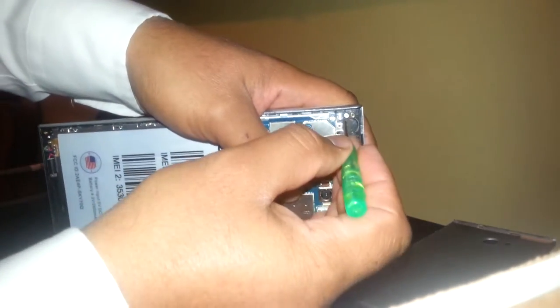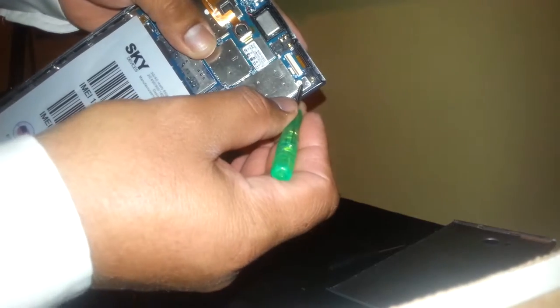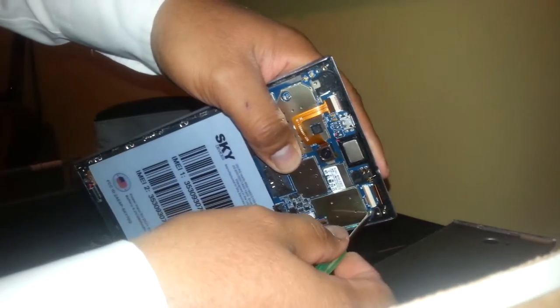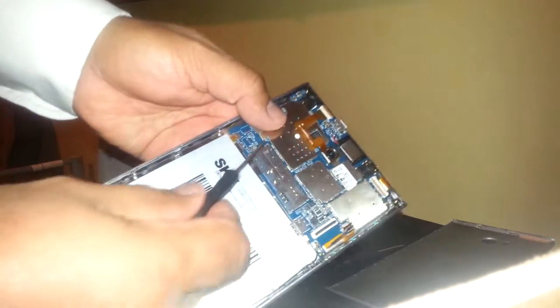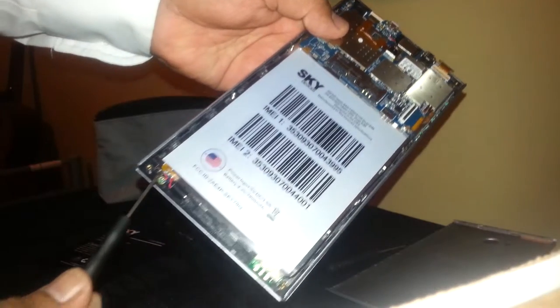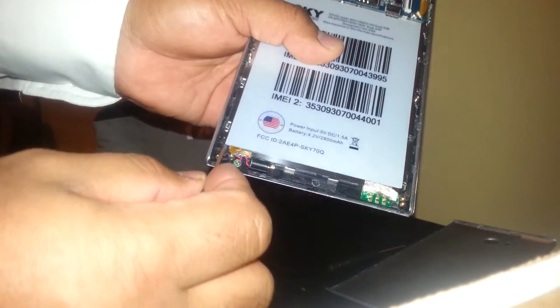It's going to be easier for you when you need to reassemble this one again. The only reason you'd open this is to replace any part that has been broken. Now that we've removed those two screws, let's remove the motherboard. But first, you see this flex cable that goes under it — let's remove this protector, which ends at the vibrator and the microphone. Lift this cover carefully.